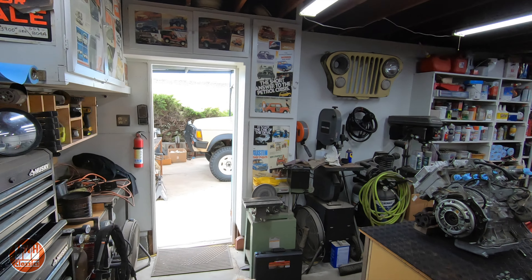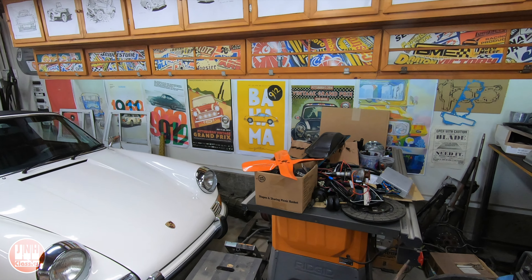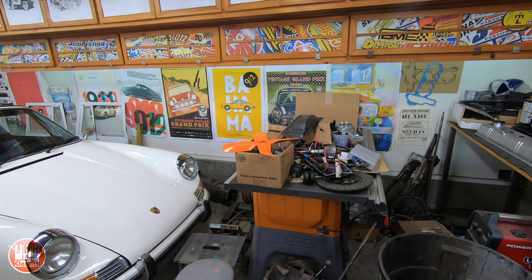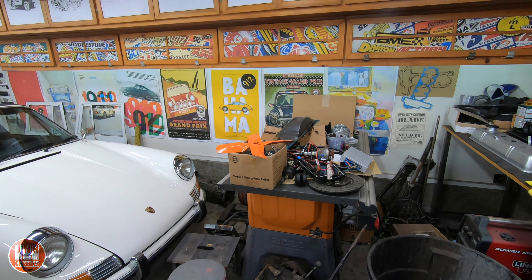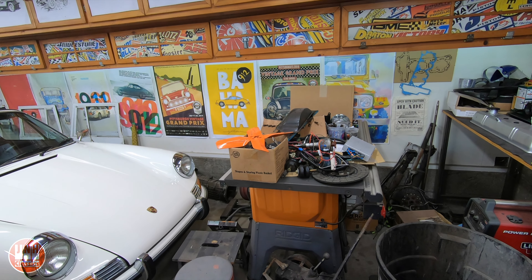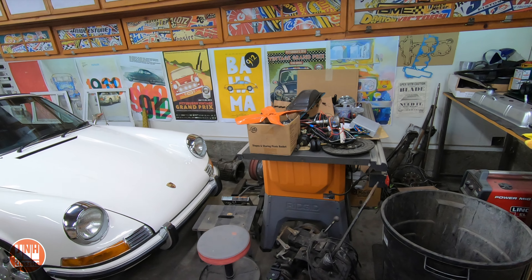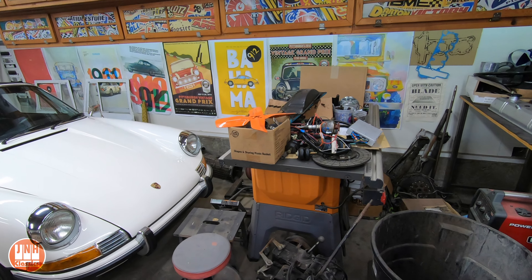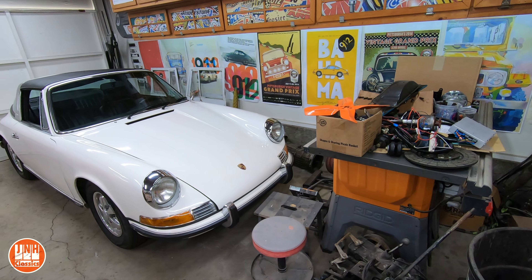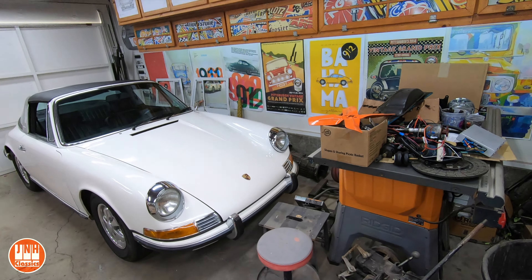For the Land Cruiser, I took the engine into the machine shop — I'm going to have it bored out, and I've ordered some new oversized pistons and rings. I also took the head in; they're going to rebuild the head. I also took the flywheel and the clutch plate in; they're going to resurface those as well. I've ordered the pistons and rings but don't have them yet — I need them before the machine shop can bore out the cylinders because they have to match. I should get the pistons and rings hopefully within the next few days.